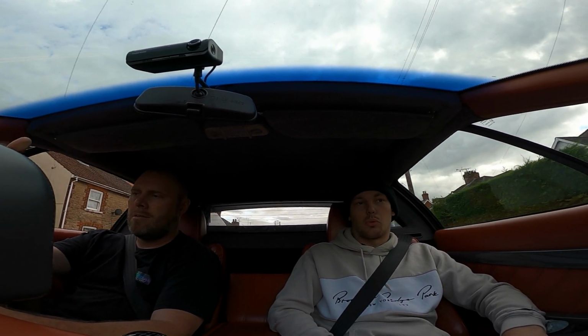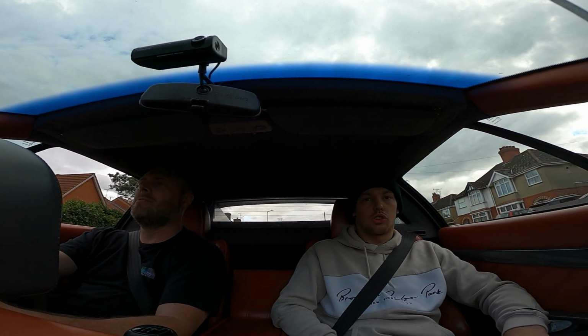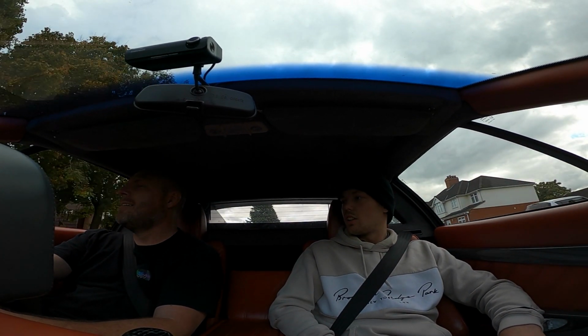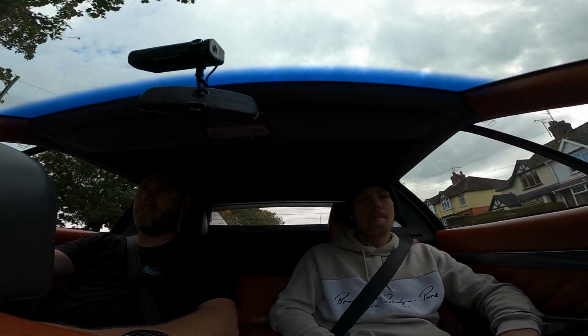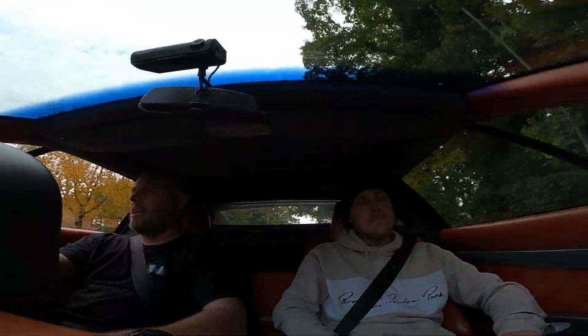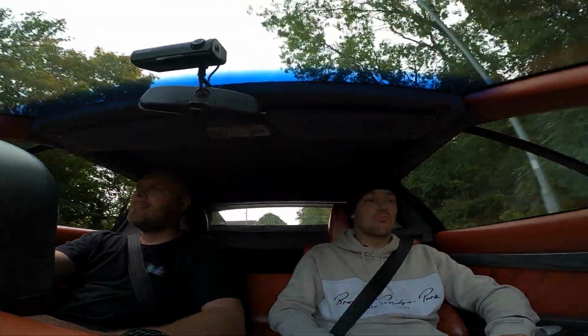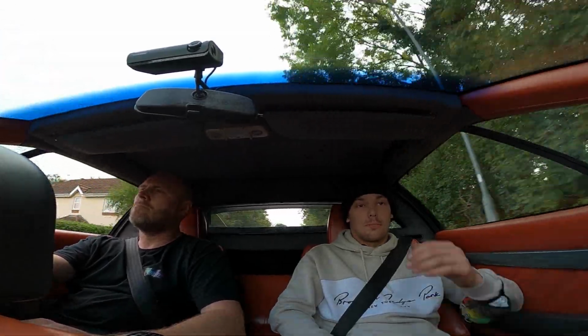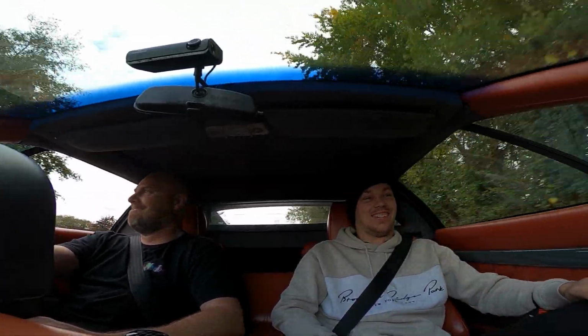Got your engine warning light on. Do you know what it's for? Yeah, it will be one of the lambda sensors. Just because it's oily. She's Smoky Joe, mate. A bit like my car. Because it can't sniff, it'll go to default, but once you get the exhaust hot enough, it stops. So it's there when you start it up because it can't read emissions properly. But when it's warm, it decokes itself and it's happy. Cool. You can full send it then when that light comes off. Well, it gives full send anyway.